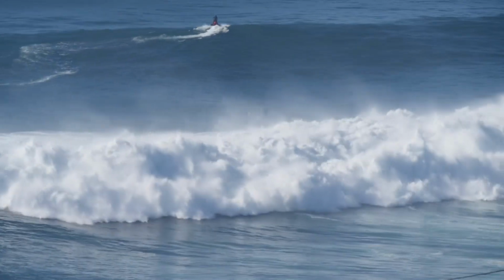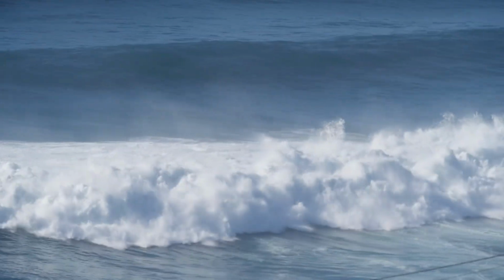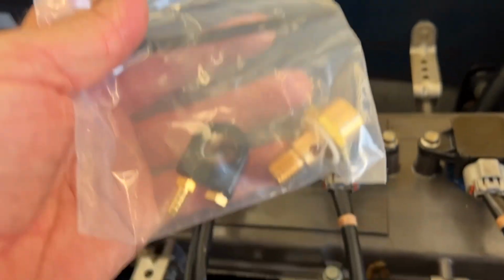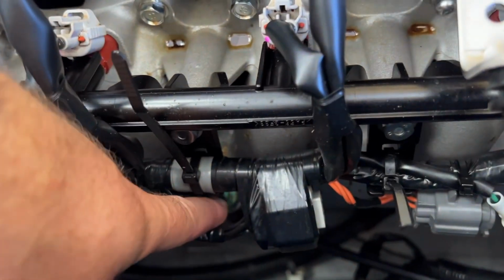And if that is being fitted, from what I read, it's best not to use the cheap tap that it comes with, where you go in on a pipe on the side there. It's best to buy an additional part which adapts the temperature sensor and fits in the center of the manifold there. I had a 2009 Yamaha FX SVHO before. It was perfect in many ways in terms of the power and the shape for punching over the waves, but there were some problems with it.